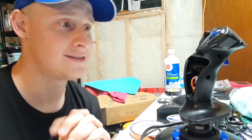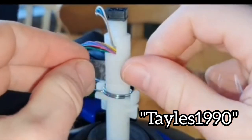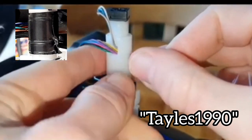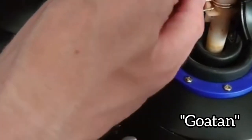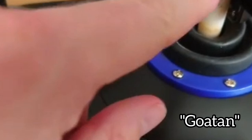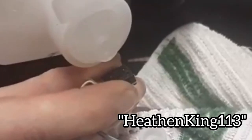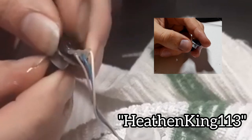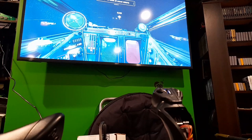The weird thing I noticed is that every single one of the videos was British — it's quite weird, isn't it? Anyways, these videos taught me so much. I came across one where someone was wrapping tape around the stick like I had found it, because they were trying to prevent issues with the potentiometer — which leads me to believe the first owner had a potentiometer issue. I also came across a video where someone had problems twisting the controller left and right, and they explained the spring was sometimes improperly set. I owe a lot to these videos. Thank you all — let's test.